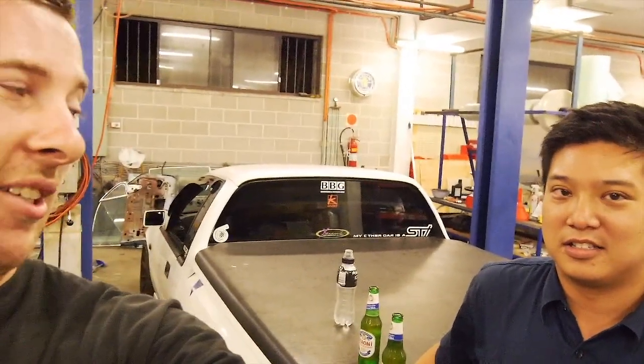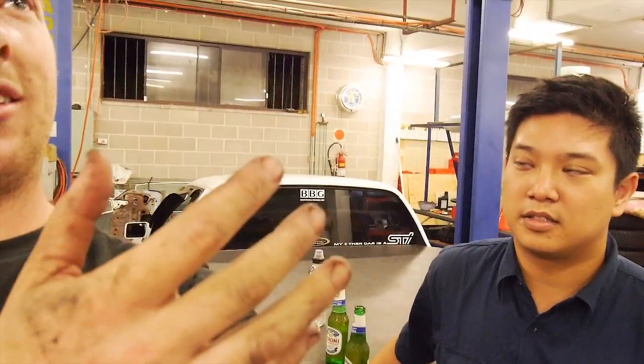It just depends on what you want to do. This may not happen to anyone else, but it's just been unfortunate that the diff took so much work to get it shimmed right for the backlash, and then it wasn't seated so we had to come back and adjust it. But now that it's adjusted nicely, we've realized that the tail shaft and uni is fucked - that's what happens. The tail shaft is probably 300-something thousand k's old. It's a lot of custom work and out of that you learn some new things - at the end of the day it's a good result.